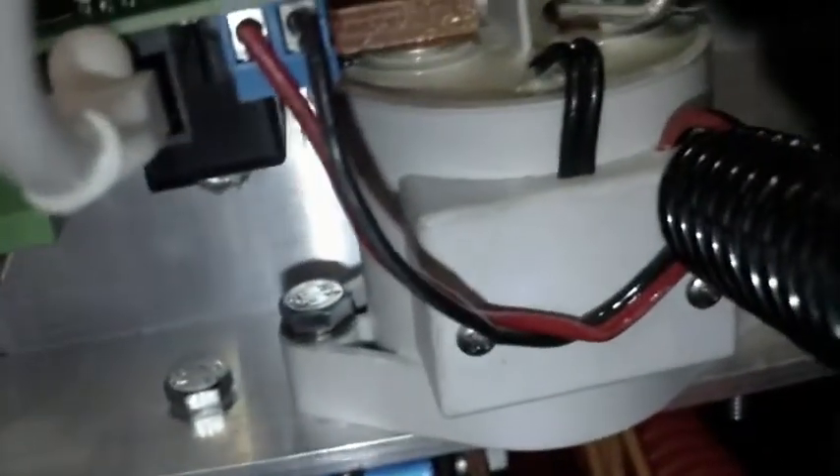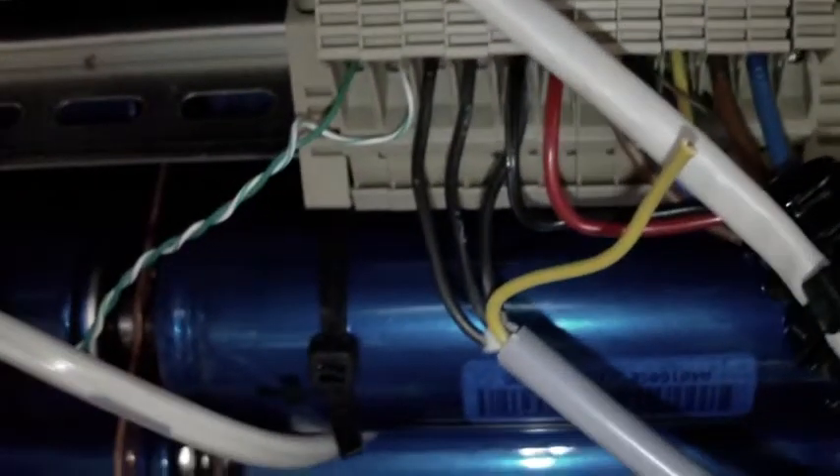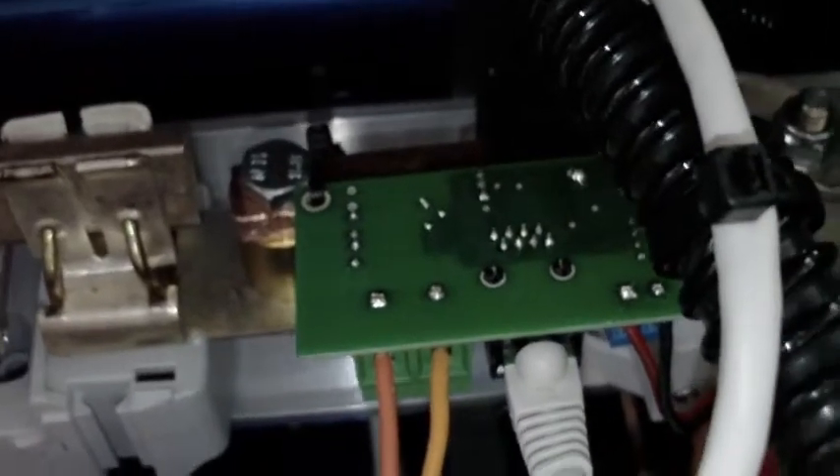Each of these tabs has got a 2 amp 250 volt DC fuse on it where it actually hooks up to the cell, so that's quite safe. The other connections are 12 volts from the accessory battery. I've got a 12-core cable that goes under the car and brings various signals from the front and back of the car. I picked up a permanent 12 volts via a 2 amp fuse and that supplies power to this card.